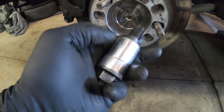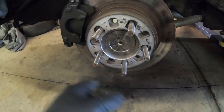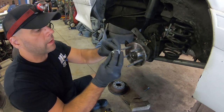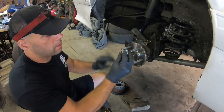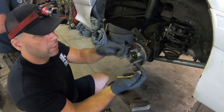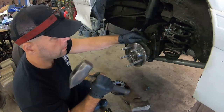So these are the spacers that go in the middle of the wheels. You won't bend these, but it's kind of surprising that I actually bend these two. What we're going to do, like we did last time, is put a bunch of washers on here, put this nut backwards, and draw them up and put a little Loctite on the other side, because the knurls on the ARPs are the same as the Moser axles.